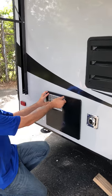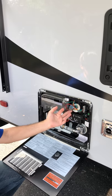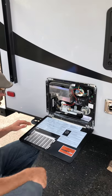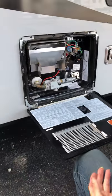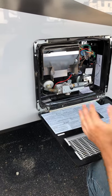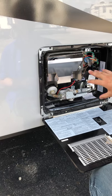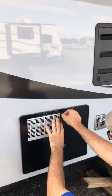We've got your water heater tank right here — it is electric and gas. You've got your blow-off valve, which we don't recommend pulling because of all the electrical components. If you want to test your hot water, just go on the inside and turn on the hot water valve. This unit has a six-gallon tank for the water heater. Right here is your drain tube — when you do the winterization or de-winterizing, that's where you pull it out and let water out. Also, this is a magnesium anode rod that will be self-sacrificing for the elements, so it will sacrifice itself instead of the elements and container getting eaten away. That will get hot when you start using your hot water, so be very cautious of that area.